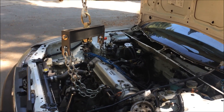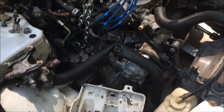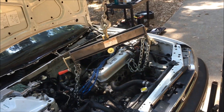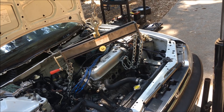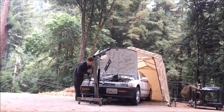I've got the shop crane ready to go on the motor. The first mounting spot is on the power steering bracket right there, and the second one's on the rear of the transmission right there — there's a hook coming out of the transmission. Those are the two places you hook it up. You start jacking it up, and as you get it taut, then you take out the mount bolts.